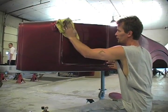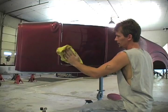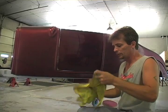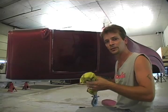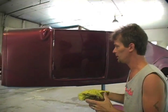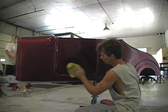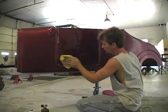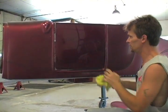This makes a good presentation for the customer and leaves a protective coating that's body shop safe. Because when you get a fresh paint job, you don't want to wax it for about the first 90 days — that's what I recommend to all my customers. As the paint cures, it's still evaporating solvents and going through its own curing process, and you don't want to interrupt that. If you do everything right and follow all the steps, be really careful and gentle, you'll end up with a mirror gloss — just a beautiful paint job.